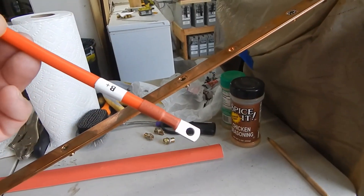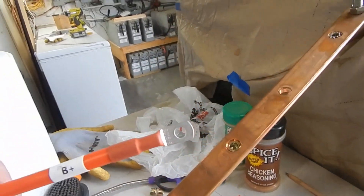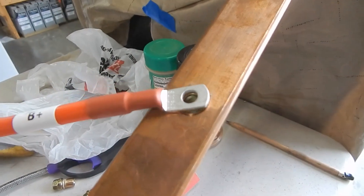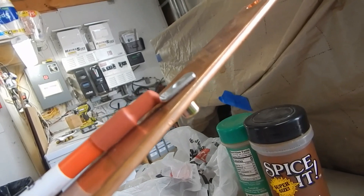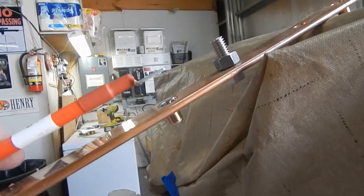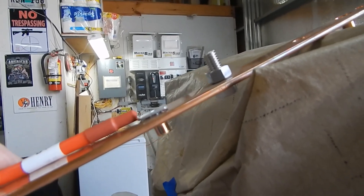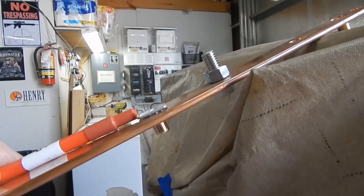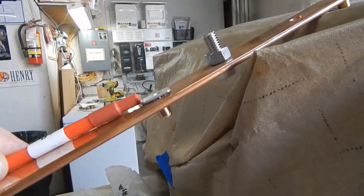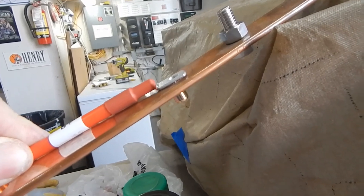I forgot to show you the actual battery cables that come with the EG4 batteries, which are kind of tiny — there's your little teeny lug. And there is a good look at the recessed dimple there with the riv nut. That little teeny lug has a space under it. But when you put that stainless steel lock washer that's meant to crush and lock, you see now it sits on top of the bus bar, it will crush into the lock washer and the bus bar, and it will remain flat with a good contact surface. That was the point behind doing that.